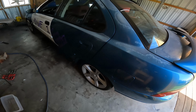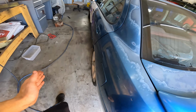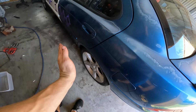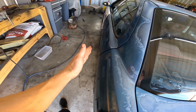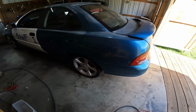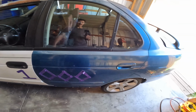So there's one thing left that I can do to the rear of this car, and that's bending the beam. So basically I can cut that beam in 2 spots, bend it and weld it back up again to get some toe out, because right now the rear wheels are pointed toward each other. If we point them away from each other, that will cause the rear end to loosen up a lot. I really didn't want to do that because it's easily screw upable, but looks like I'm gonna have to.